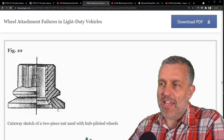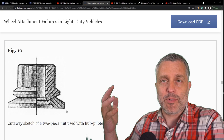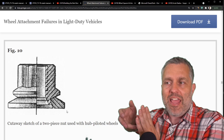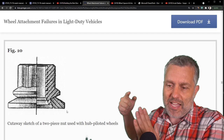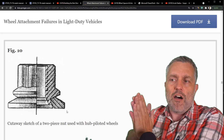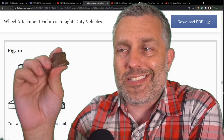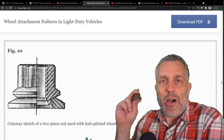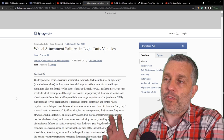One of the most important things I learned from this article is the existence of a particular style of lug nut. You see this corner here that looks detached? It is — it's basically a strangely shaped washer that allows clamping force: the washer clamps to the face of the rim while the rest of the lug nut spins. This means more of the spinning motion gets transferred into clamping force and less is lost to friction. I don't have this style — mine look somewhat similar with a nice flange for a flat bearing surface, but it's one solid piece with no built-in washer.